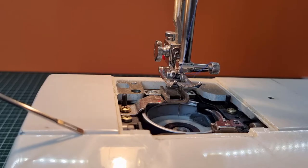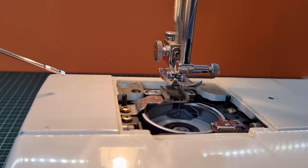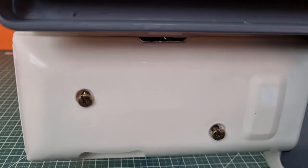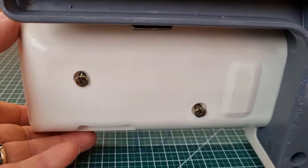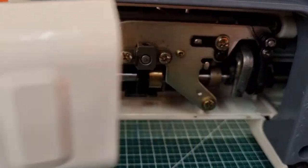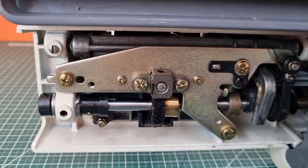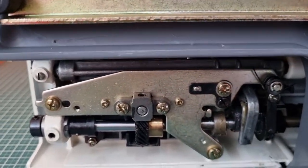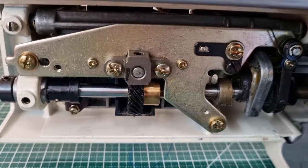On the left side, when the needle comes up the hook comes around and you can see the needle is starting to come up in line with the hook — and this is what we want to have on the right hand side, which isn't happening. You can see the lowest point of the needle on the right is almost where the plastic section ends, quite a bit down from previously. I'm going to turn the machine off and turn it over and have a look from underneath. I'll just remind you: you should always have your machine turned off when doing any servicing or repairs, even when taking the plate off with the bobbin case. I sometimes like to remove the needle as well just so that I don't accidentally stitch my finger.